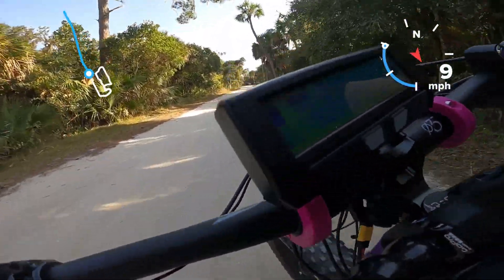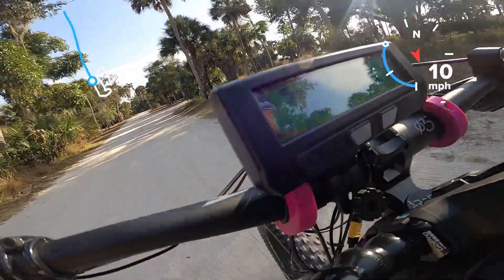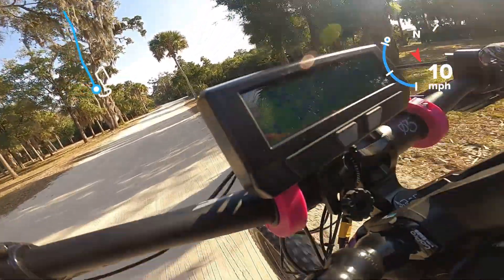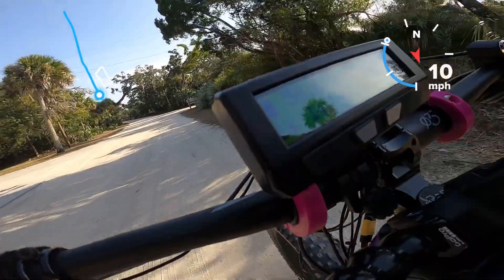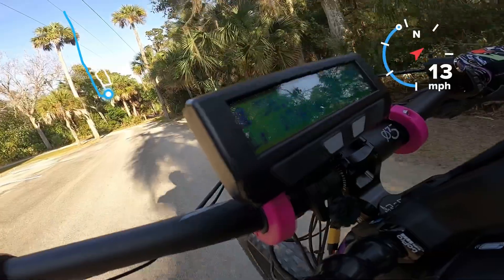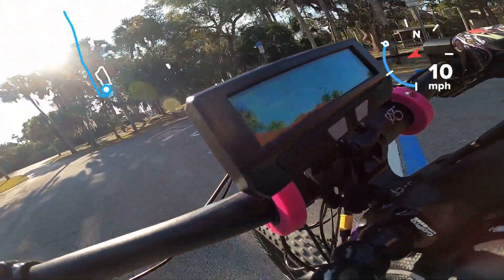Pretty much the wheelie doesn't come in — I'm not the best at doing wheelies. It has the power to work with that field weakening whenever I want, and also hit 20 miles an hour. That alone honestly makes it the next best thing to having 72 volts. I have a pretty big pack — a 52 volt 28Ah cycle pack — so I have some power to back up the field weakening. But if you have the pack and a metal gear and your bike can handle it, I would definitely give it a shot.